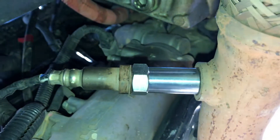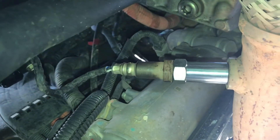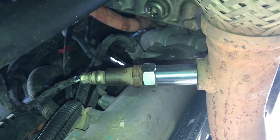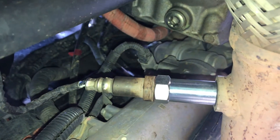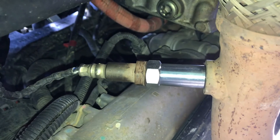I'm going to show you that piece — I've got it stopped right in the bottom. That's it, it's just a temporary fix. That's the downstream O2 sensor. There are two O2 sensors: one before the cat and one after the cat. You do this to the one after the cat — you move it back so it does not get a lot of heat from the engine.